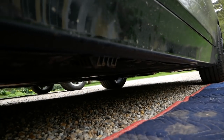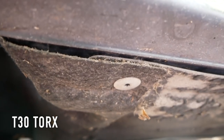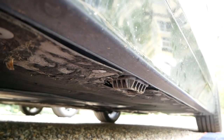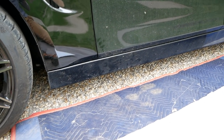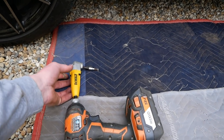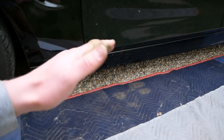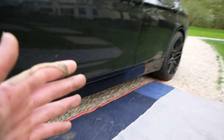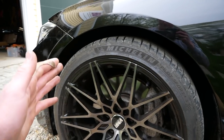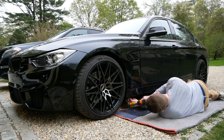Show you the screws we're removing. We're removing these plastic T30 Torx screws. There's a whole bunch of them that go down along the car underneath the side skirt here. They are plastic, so be careful with them. And again, I can't stress enough how crucial this right angle driver is. It makes this job go really quick, and I've actually found it quite helpful for a number of other jobs, including installing my rear bumper and front bumper, so definitely pick one of these up. I'll have a link to one in the description below.